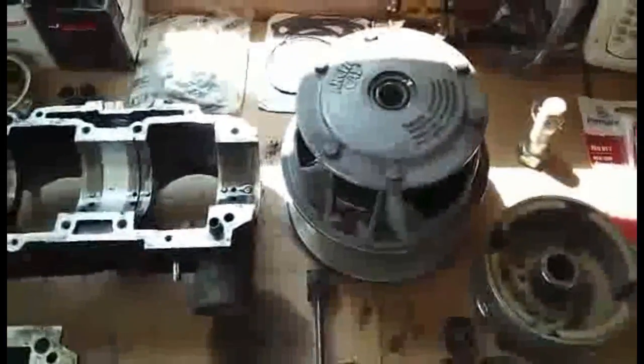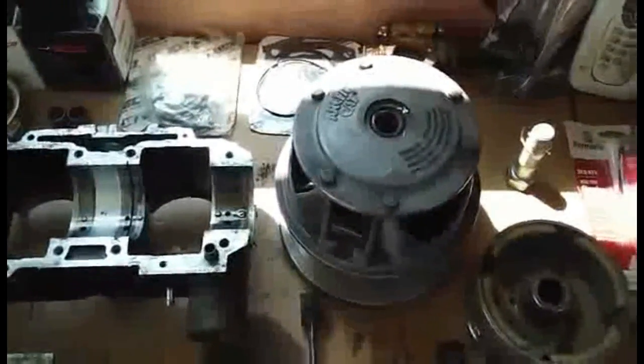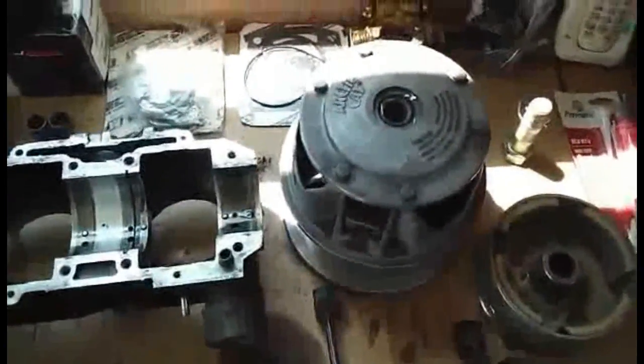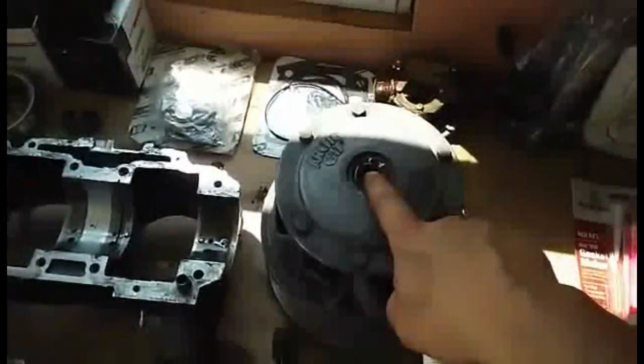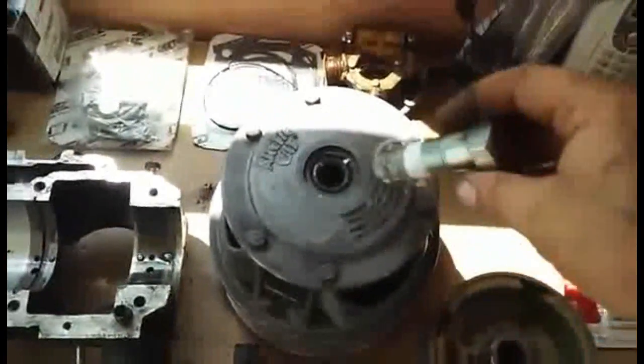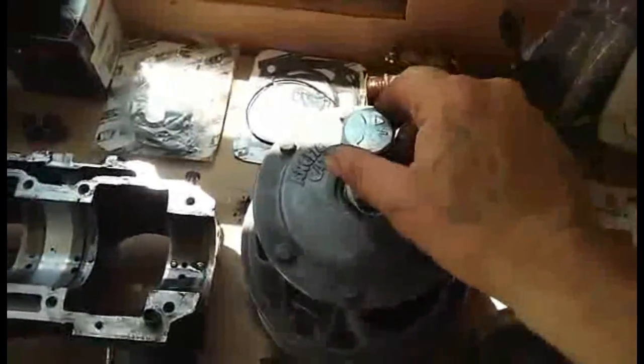Here's the clutch. That gave me a little bit of a hell of a time, but I didn't use a clutch puller. For any of those Arctic Cat enthusiasts out there, just so you know, you can actually take a bolt like this — this is a 7/8ths fine thread bolt, it's got a pretty big head on it. You Teflon tape the threads just like that, then you pull the center bolt out and put it down inside here. Then you fill this up with water while it's attached to the motor, so it'll fill it right up level. Then you really Teflon the threads real good and thread it down in there. Once you get it down a certain distance, it'll start to tighten up.